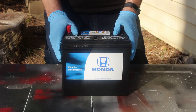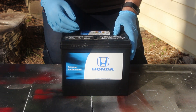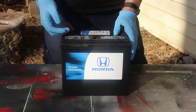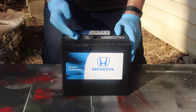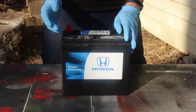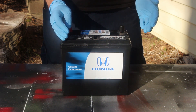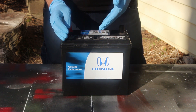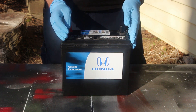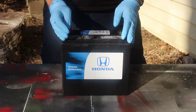There are a few things you need to remember when you're going to replace your battery. One is that when you disconnect the battery, the car's computer will lose power and then it will lose its memory. That means any diagnostic codes will be lost and the check engine light will be cleared. It will also forget the emissions monitors, and if you live in a state like New York that has an annual emissions inspection where they plug into the car and see if those monitors have been run, you can't replace the battery right before you do that without driving it to set those monitors.